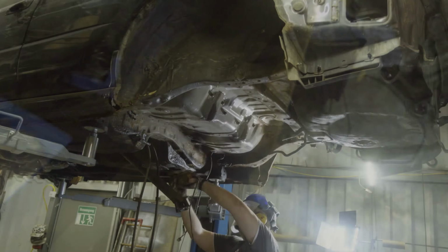And here's our beloved rust hole, which goes directly into the cabin underneath the rear passenger side. Cut out the brake hose stuff. Oh yeah, that has been the holder for the bracket of the brake hoses. For God's sake, glad I ordered a new one. Again, rust and pitting, rust and pitting. My angle grinder doesn't reach into that corner, so I gotta use a different tool for that. Didn't do the middle section yet, but it's again rust and pitting. Rust in between the metal layers. Oh, there's even a little bit of movement, but that might be original.